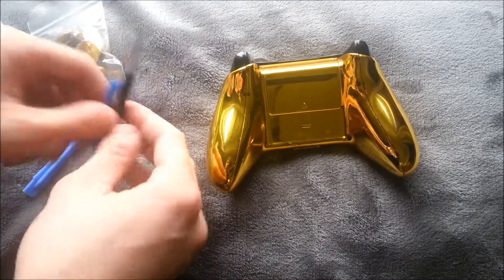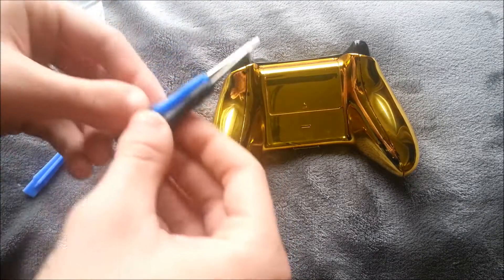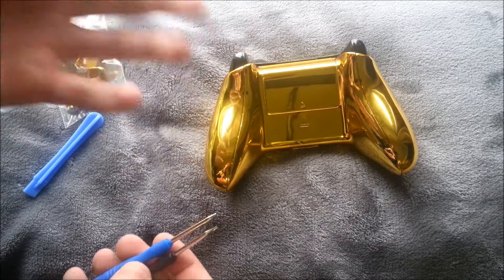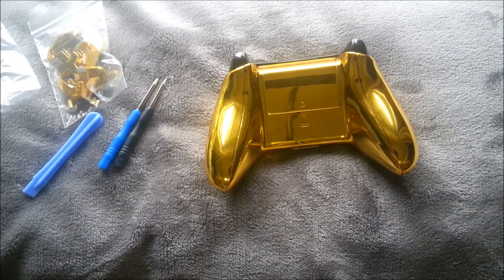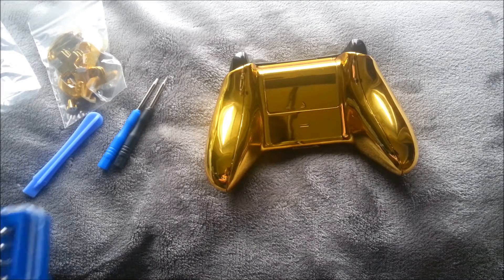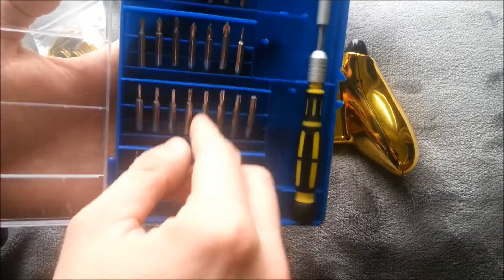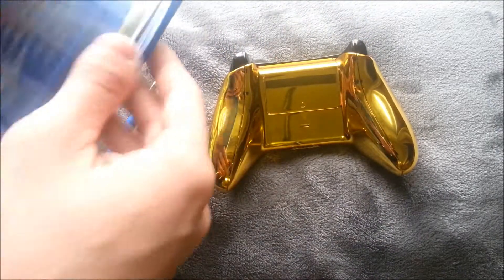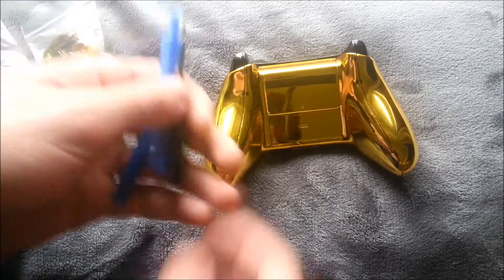I do suggest you go out and buy an actual T8 screwdriver — you can get one from eBay for like three dollars. But I've found that Microsoft makes their screws differently shaped, so you might need multiple sizes. If you're installing the shells, you might want to buy a cheap screwdriver set — I bought one for like five bucks and it has all the star sizes you need. Sometimes you might even need two different sizes for the same screw, but that set gets included with each shell.